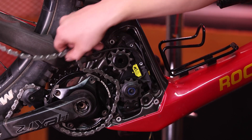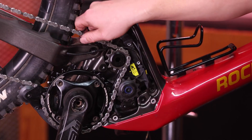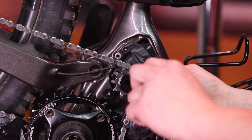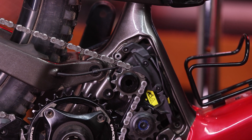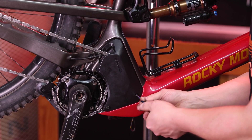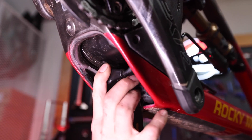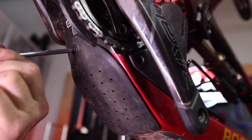Position the chain on the drive cog, torque arm, and cranks correctly. Reinstall the upper chain guide, making sure to have the derailleur housing in place correctly. You can now tighten down the upper chain guide with your 2.5mm Allen key. With your 3mm Allen key, you can reinstall the drive side cover plate for the motor. Re-plug the motor cord to the battery and reinstall the battery cover plate with your 4mm Allen key.